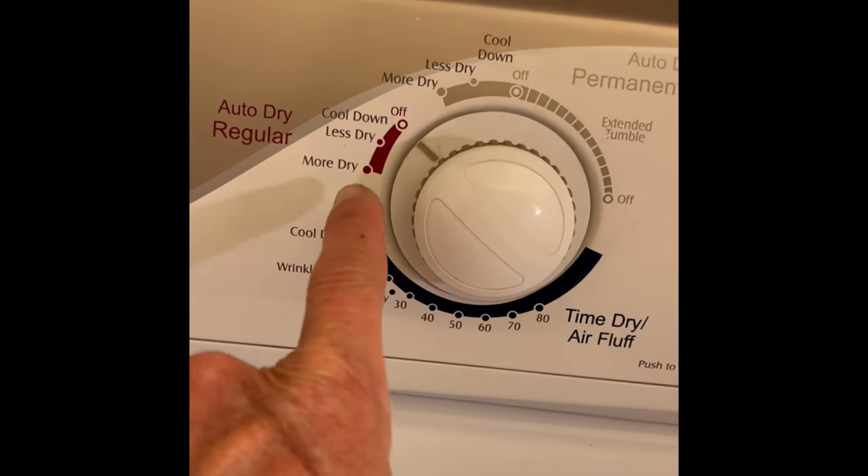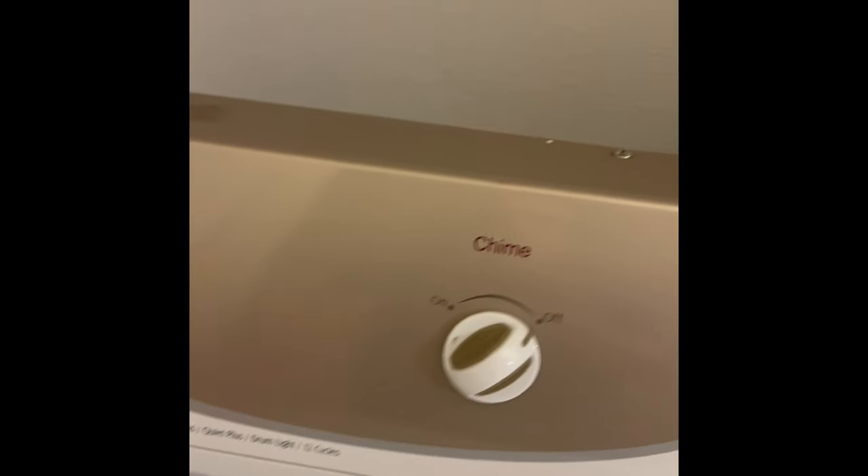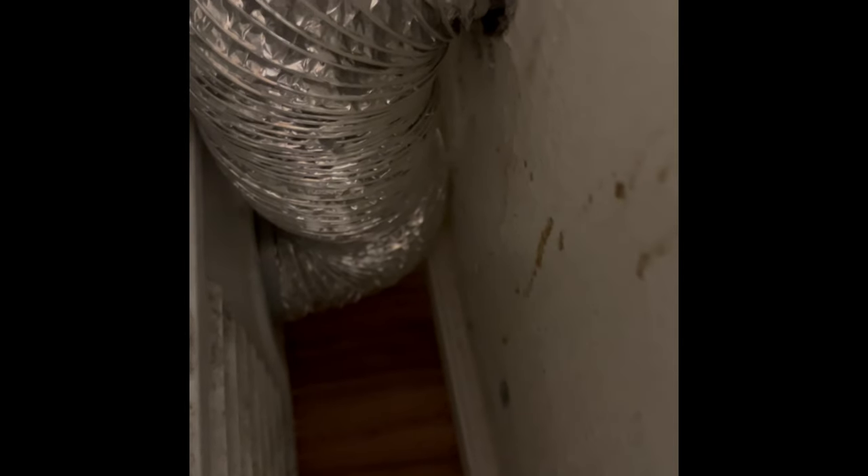Now I'm going to do a test. I'm going to set it for more dry or regular load, regular temperature — which is the highest temperature — and put a lot of clothes in. Here's the dryer vent tube; I straightened it out a little bit because it had more turns in it. The more turns, the more likely it'll overheat, so I tried to minimize it to two turns. I've got it full of clothing to give it a good test, and it did great — it did not cut off and it went full cycle.